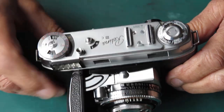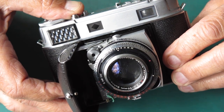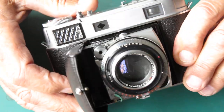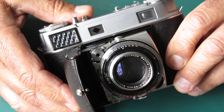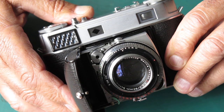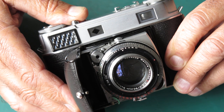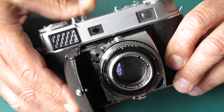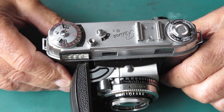What's happening is that as you press on the shutter release, the first thing happening is that click releases the film advance. If you press a little bit further you get the click for the film advance, and pressing further still the shutter fires. Those two actions should ideally happen at very much the same point.